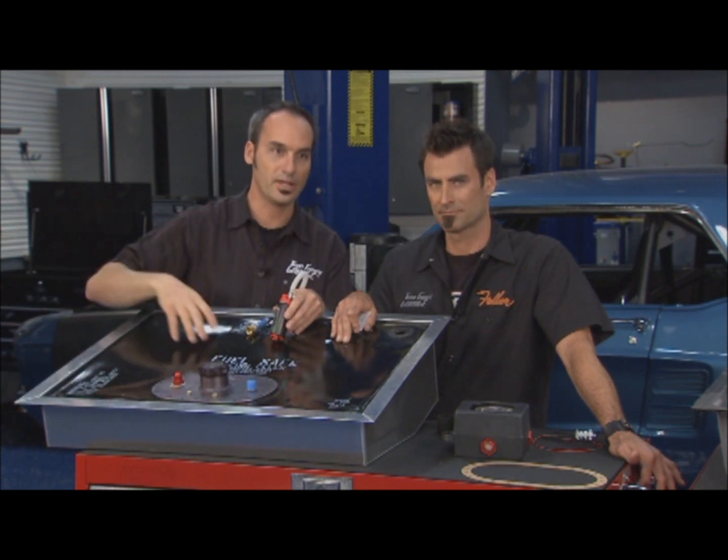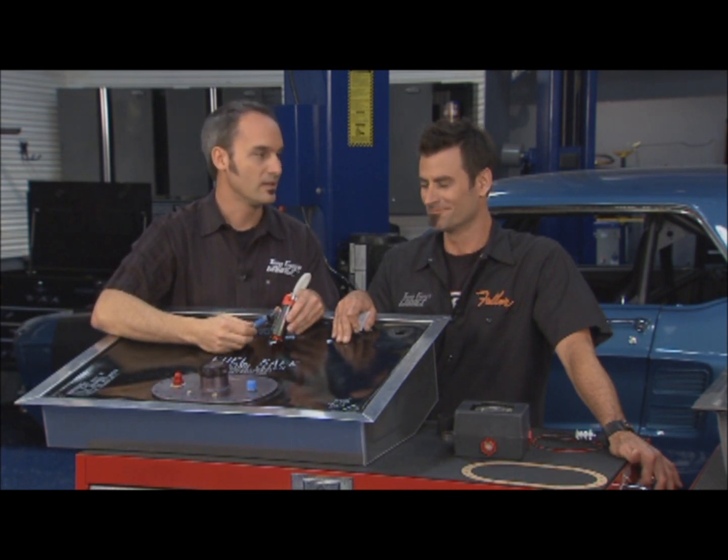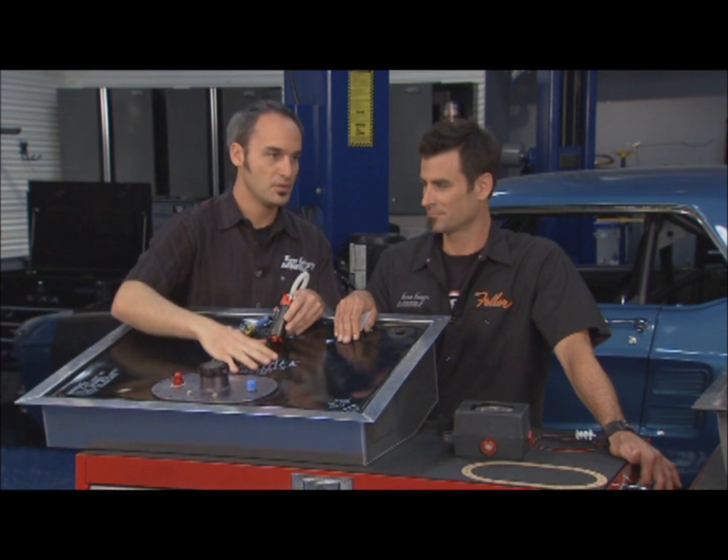When you're pulling a vacuum to get that fuel out of the tank and to the pump, from there it's not a problem — you're pushing and building a lot of pressure. It's pulling that vacuum that's the issue. You're lowering the pressure, lowering the atmosphere essentially, and you're lowering the boiling point. So you're going to cavitate and vaporize a whole lot sooner. On return-style fuel systems, you're sending a lot of fuel to the front ready for wide open throttle, and when you're not at WOT you're sending a lot of that back — and it's getting warmed up. So your fuel is building heat over time, getting heat off the pavement, and getting closer to that boiling point from the other direction. Cavitation is a very easy thing to trigger.